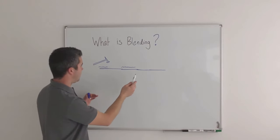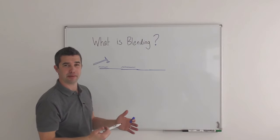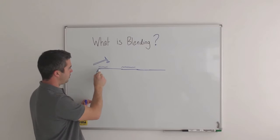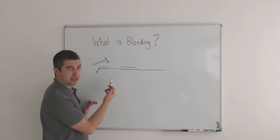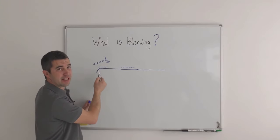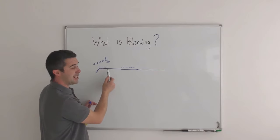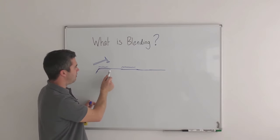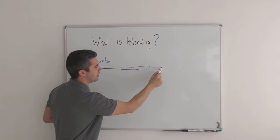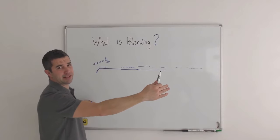For example, in the blending part one video we are working at the edge of a panel, so once you've got that kind of fold or edge where the roof comes down, the energy can't go further than the end of the panel or the tight spot in there. So as you're tapping - although we're tapping on the front left corner - the energy stops when it gets to the ridge but continues on very lightly and probably just fades out right across to the back section of the panel.